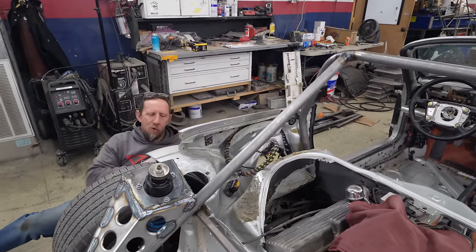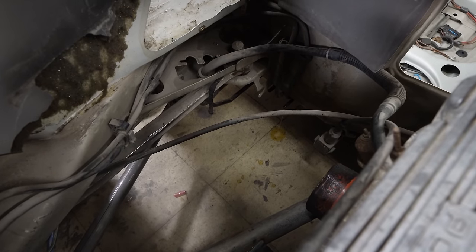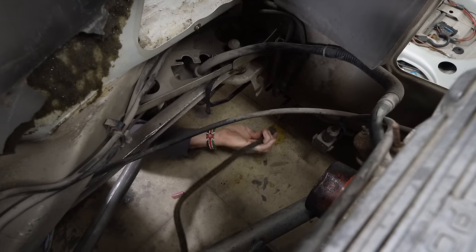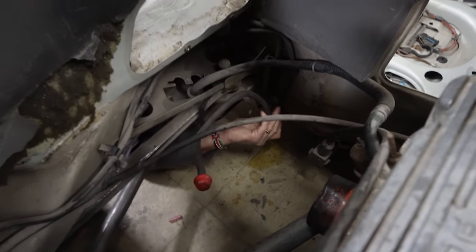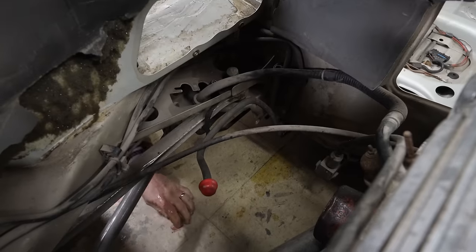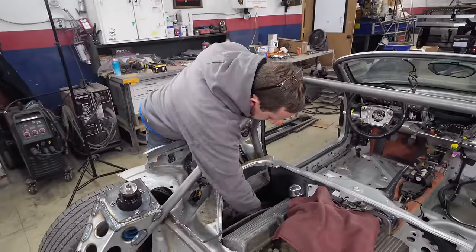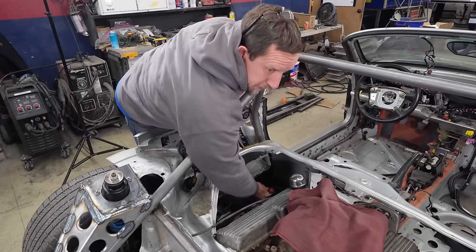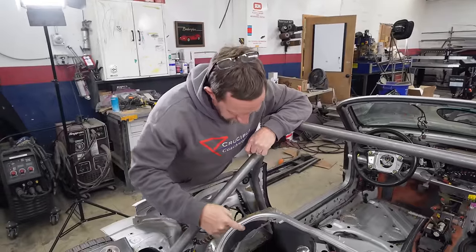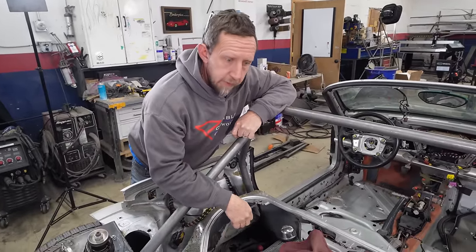So I'm going to install the fuel line I took off of the engine down on here, which means crawling on the floor. And dumping a little bit of really nasty gas out onto the floor. Just clip into place. Which is why we like it. And it's way easier to adapt to this steel fitting with an AN adapter than trying to do anything with that fuel line with the quick release.